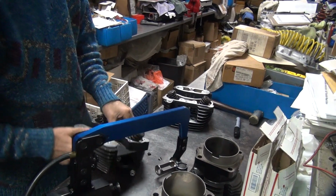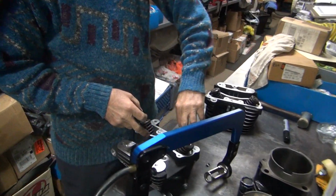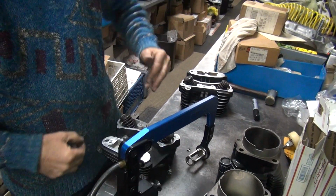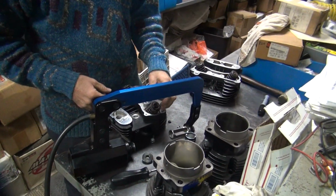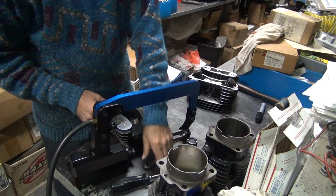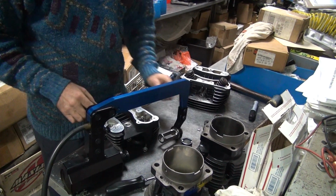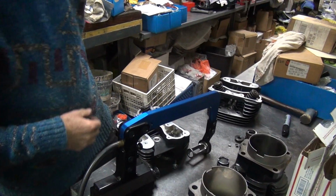Under a bit of pressure there. Well, it's got way of the head in here, and it jams it right in there. It wouldn't come out either. Release the tension. So don't get your finger stuck between the valve spring and the side of the head when you disengage it with a power tool.